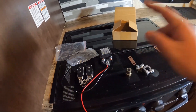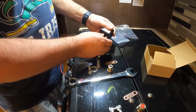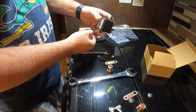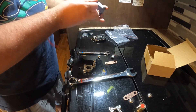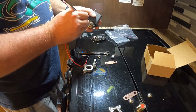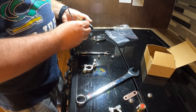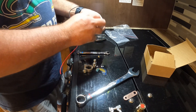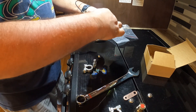I'm going to put this together, turn the RV off, and hook this up onto the RV to make sure it works. I already took off one of these posts and I'll take off the second one — these are 10 millimeter. I'm going to connect this negative post, which is where the current battery cable will go. That's a three-quarter inch ratchet. I'm going to put the smaller hole on the remote control box and tighten it down nice and snug.